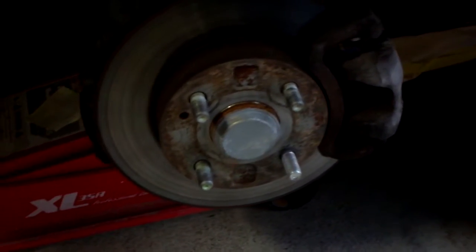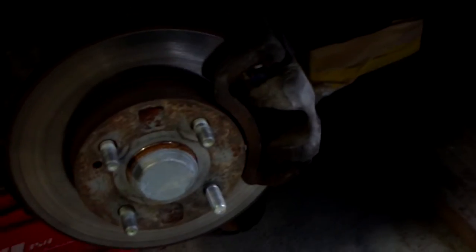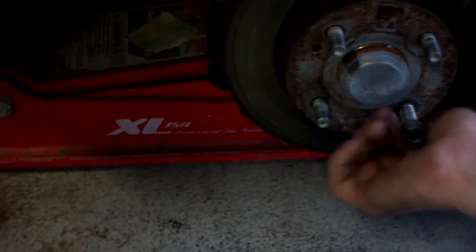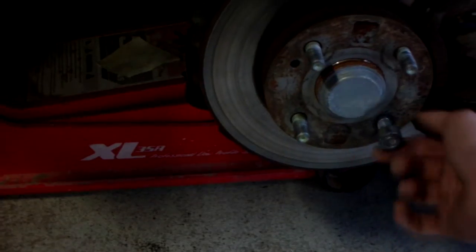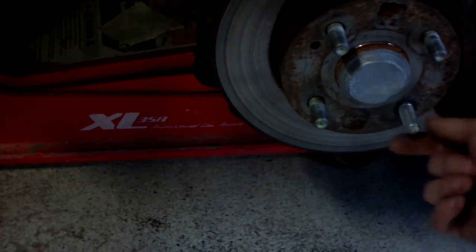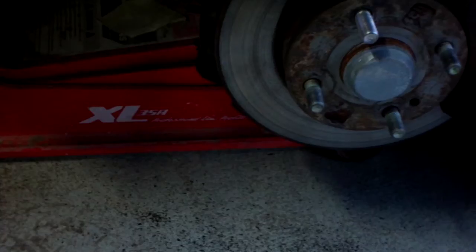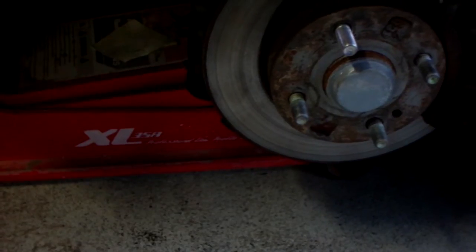I could actually put 4 lug nuts on my wheel, which is quite a relief, because it's pretty sketchy riding with 3 lug nuts. But yeah, so that's the install on the stud. Sorry I didn't get banging it off, but pretty much what you do is you put a nut on the end of the bad one, but don't thread it all the way through, just put it at the very beginning, and you just bang it off and make sure it's not hitting anything back here because you could screw up your suspension. But then you take the stud out, put your new one in, then you do the washer thing like I told you guys, and you stick quite a few washers on there and you tighten it up until it's pretty much flush with the other studs. So yeah, that's the stud portion of it.